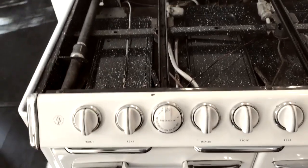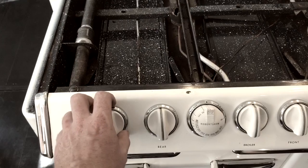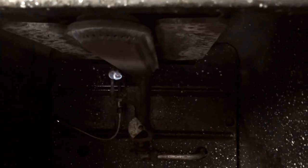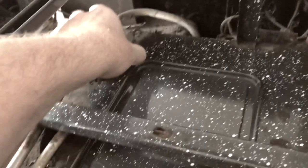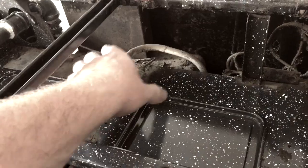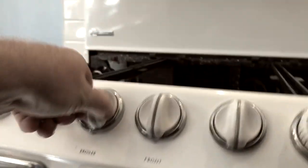These are the knobs that we had to pop off and degrease. When I reinstalled them I put a little bit of plumber's putty in the back so that the chrome piece would stick better to the face plate. You can see we have the pilot lights going and there's a burner right there. There's a safety mechanism — after the pilot light's been on for about two minutes, you have to hold this button for about 45 seconds and then it will kick the burner on. Yeah, bingo — that's good to know.